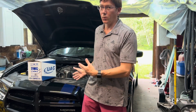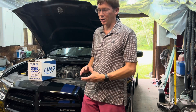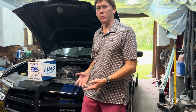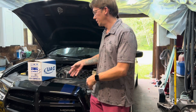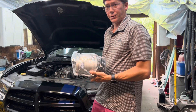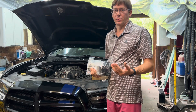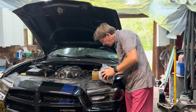As you can hear in that opening video, this AC compressor is noisy — it was underwater. The clutches and everything just got really noisy. I already discharged the system getting ready to put in a new one. There wasn't really anything hardly in there, it probably leaked anyway. Picked up a new compressor from RockAuto — it's like $175, super cheap. Even junkyards want around $100 for a used one, so $175 seemed definitely worth it.